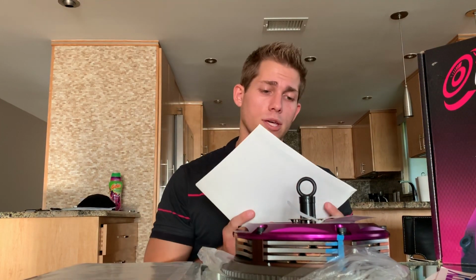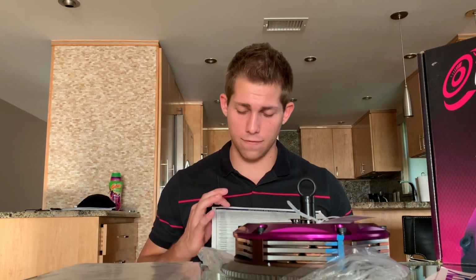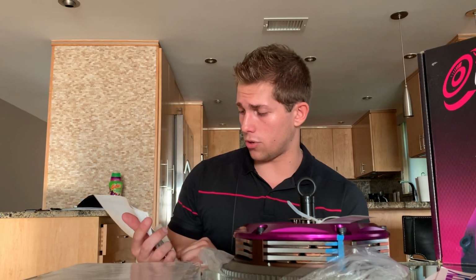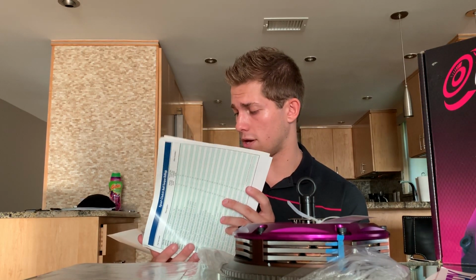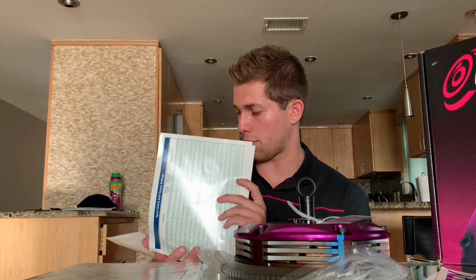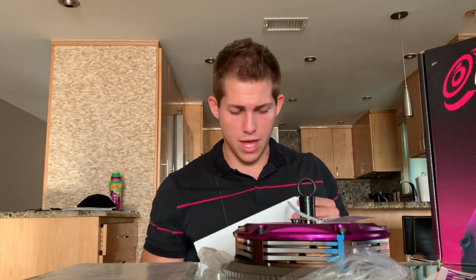On top of that, which is very handy to have, they give you the sport clutch bolt torque rating sheet. This chart consists of a lot of makes and models. Just to name a couple, there are cars going as far back as 2001 for a Mini Cooper S, the Ford Focus, the Subaru Impreza, and finally on the third page is my car, the Mitsubishi Lancer Evo 10, 2.0 liter, at 23 foot-pounds for the pressure plate cover assembly to flywheel. That's something to get into.